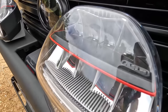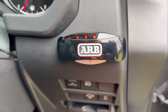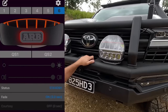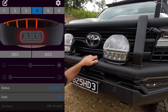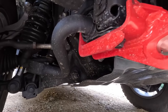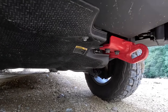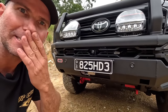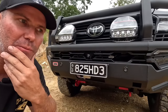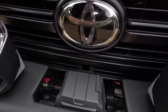For spotties on this bar we've got the ARB Intensity IQs. They've got spots, floods, and work lamps — all adjustable via an intelligent controller inside and also on an app, so you can set preset buttons for what light comes on and what intensity level you want. They're probably the brightest spotlight I've had on a car. Underneath the bar we've got ARB recovery points bolted through to the chassis, one either side, fully load rated — very vital to have those, not like shipping tie-down hooks which can be very dangerous.